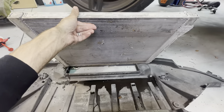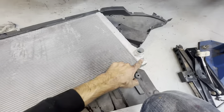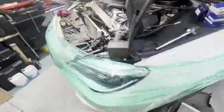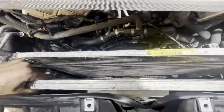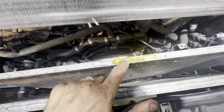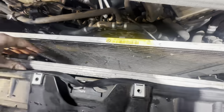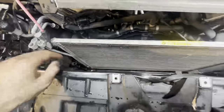This is the radiator that sits behind the auxiliary radiator in the front — just one here, one here, and one here. Very nice, all one piece aluminum. Now what I'm going to try to do is remove this auxiliary radiator from this car without removing the condenser — they call it a capacitor but this is just a condenser — and the receiver dryer is right there. I'm going to try to carefully leave this off to the side while pulling this up.